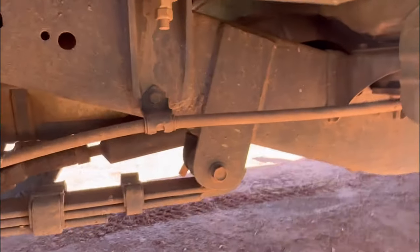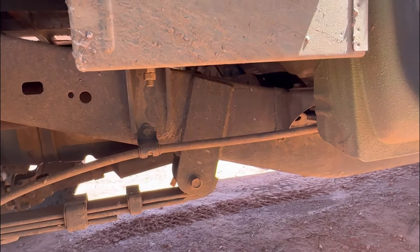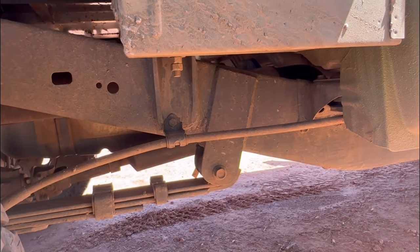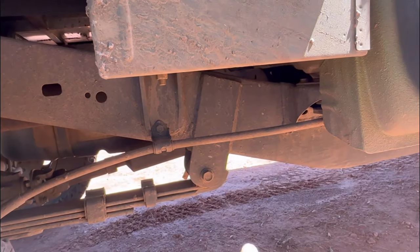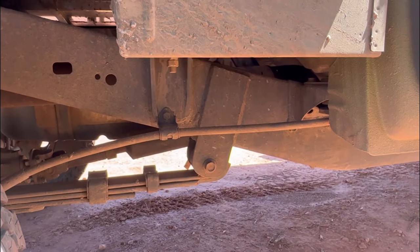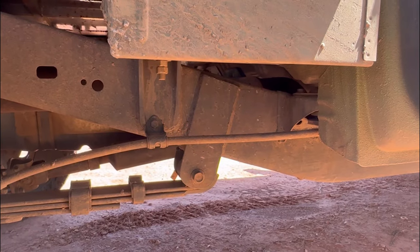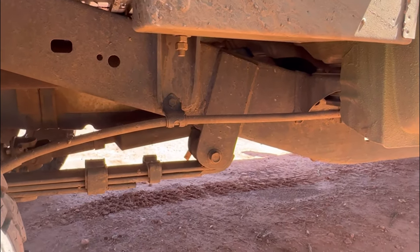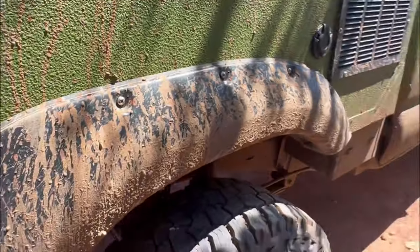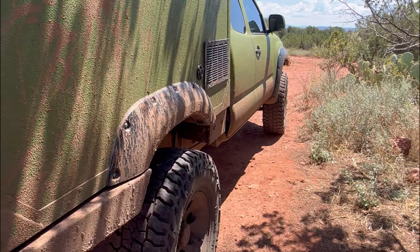While I was at it, I went ahead and made custom brackets for the front. If you've worked on Toyotas, you know the leaf springs and the heavy brackets that go to the frame — they're not fully welded, they're pinned. And that's just the prime location for salt and water and mud and everything corrosive to build up and eat through that. This truck had spent three years in Michigan, so there is a little bit of rust on it. So I just went ahead, cut those out, and made my own setup.